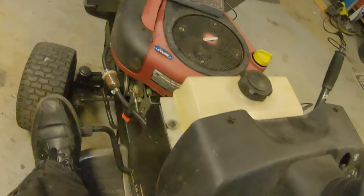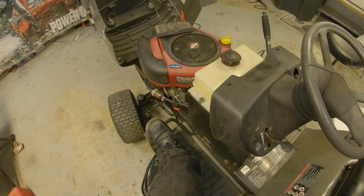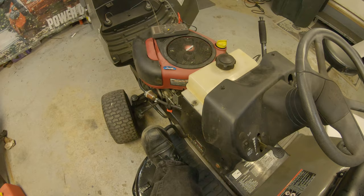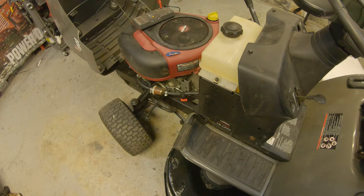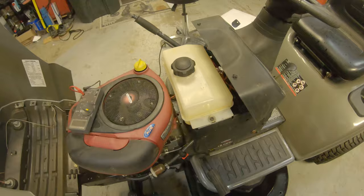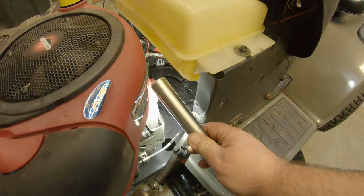Here's the problem — this switch is working intermittently. If I let that up just a little bit, there are kind of a few dead spots in it. Right now that should be buzzing because the brake pedal is released. Right now this mower would still be running — so that safety switch for the brake pedal is not making contact. I'll go ahead and replace that brake safety switch and then we'll check it out again.